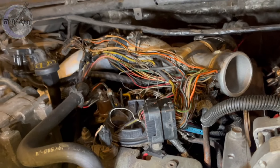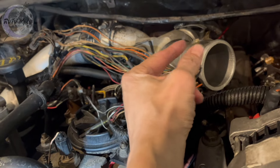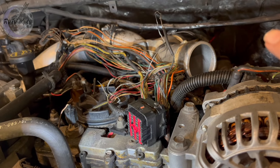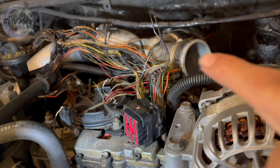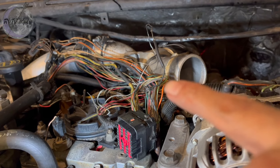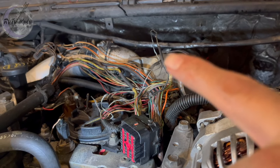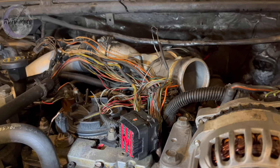Okay, I just went through a huge education on this wiring harness. Here's that crazy ground wire that is exposed and bare that I've been showing you guys. Believe it or not, that is actually how it was shipped from the factory. This uses an ultra high frequency wire setup for the fuel injection system, and because of that, they don't want radio interference. So they wrap those wires with foil tape, and then they wrap it again with ground wire just to keep it quiet. I didn't know that at all — I just saw some bare wires and started freaking out.